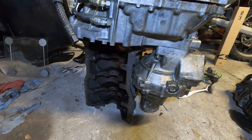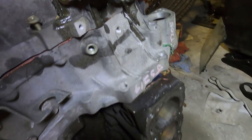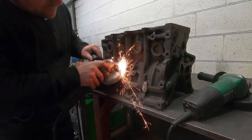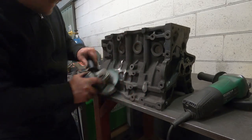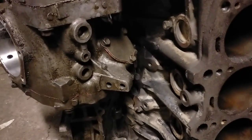I've got my freshly ground 5S block with the dummy casing of the Celica GT4 gearbox - I just need to check clearance before it goes off to the machine shop. Unfortunately it's still touching on a rib in there, so it's not going to sit in its proper place. I'm glad I checked this - we'll whip the gearbox back off and re-grind it. There we go, it's all fitting now. It took me six or seven passes to grind off exactly the right amount. I don't want to take off too much material and weaken the block.